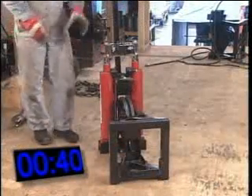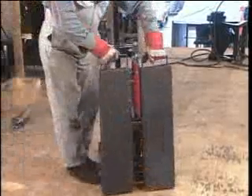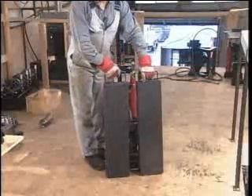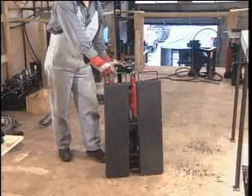All you do is connect your hydraulics and set your shoring blocks in front of the machine. These shoring blocks are made of two-inch steel tubing sandwiched with plywood on each side, and they will allow a complete 40 tons of pulling power against the block.